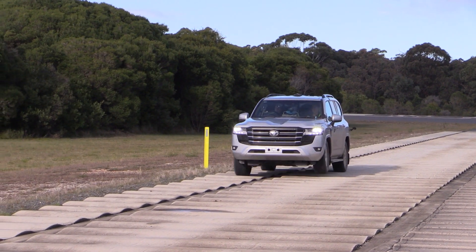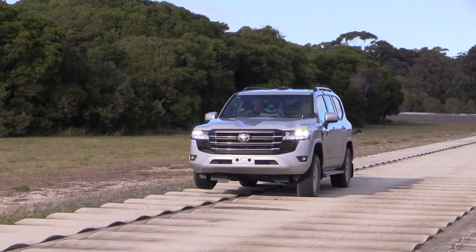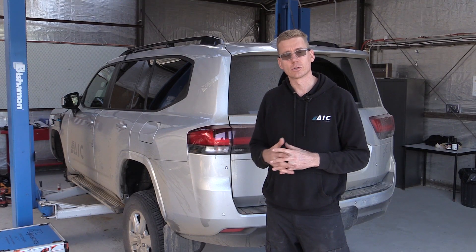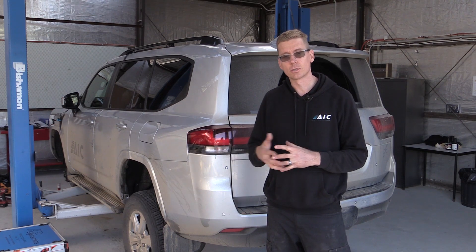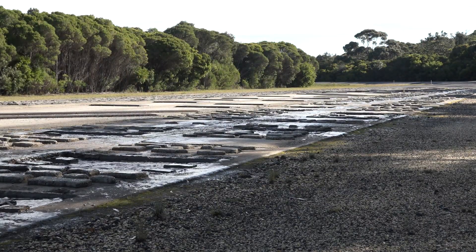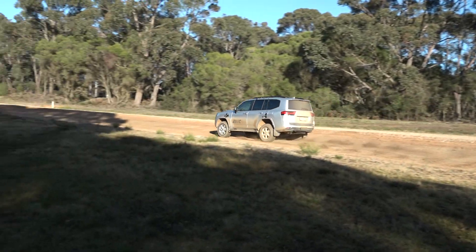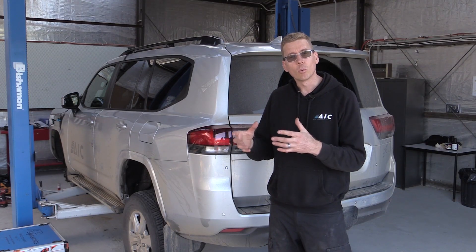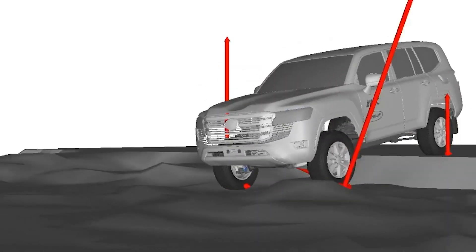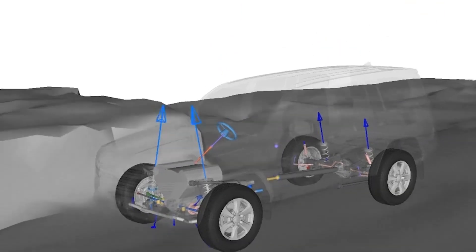Then we're going to progress on to the rough road surfaces and various rough courses to understand what accelerations the wheels are seeing and when we're getting bump stop engagement. This gives a good representation of the worst case this vehicle is probably going to see in its life — fully loaded, riding over a really rough dirt road at higher speeds. All of that data will get fed into the model with the modified suspension to understand, at the high GVM with higher spring rates and different damping rates, what the life expectancy of our customers' aftermarket GVM upgrade kits will be.